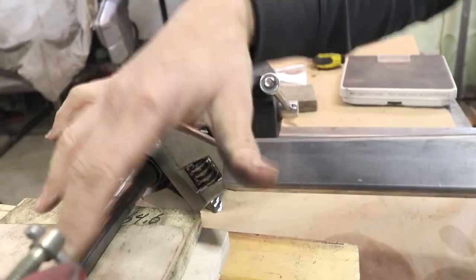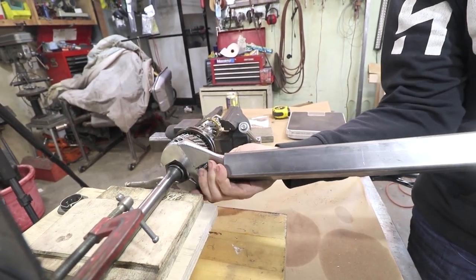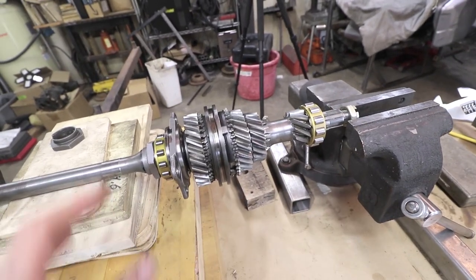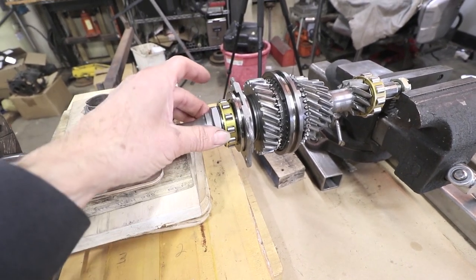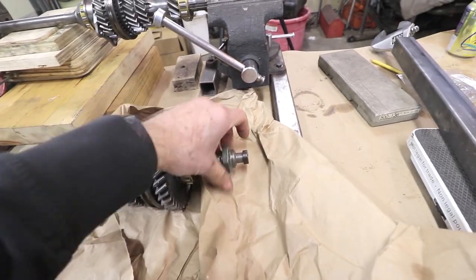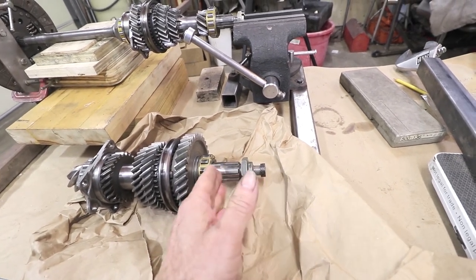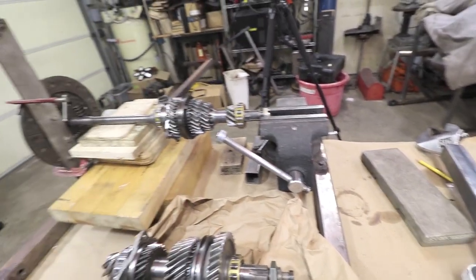I didn't see any major bending or any bad things happening to the shaft, so I'm in good shape. This is the part that gets pushed into that little divot — that creates the locking feature. If there's a problem and I need to take this back off, I'll do that before I pound that in, so I'll put a note on here to remind myself to indent this. The pinion shaft is also complete — it gets a nut on the end, which I got a new one for as well. But I can't torque this nut until it goes in the housing — there's the stack up here which is reverse and fifth gear on that side. We'll get this torqued as well with the nut on the end. That will be next week.